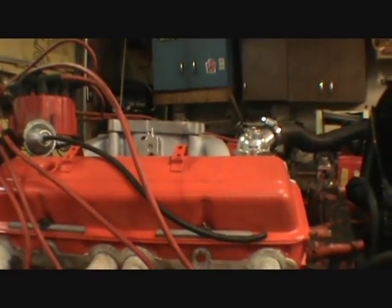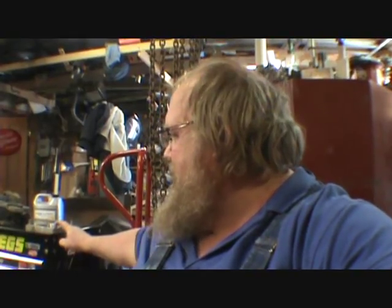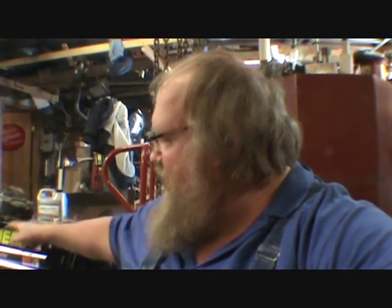I put the Holley on there and the butterflies hit the Quadrajet bore. So I went to put the adapter on, and where that needs to get bolted to the plate is where the studs need to go. I'm like, that's not going to work. That carburetor I got is what they call a spread bore, and I don't have a spread bore intake. If I had my old 2-barrel carb, I would put that on here, because I got my 2-barrel spacers right there.